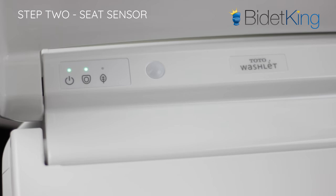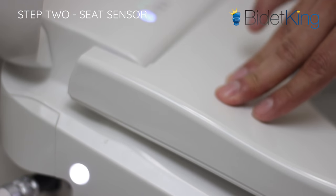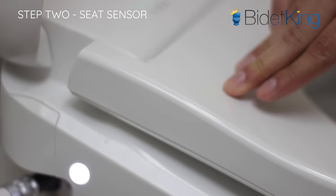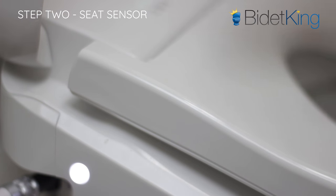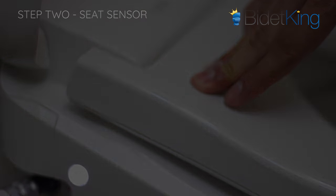If you have a Toto washlet or other bidet model that uses a weighted seat sensor, we'll have to trigger it using another method. With the seat down, press your hand down on the seat near the left rear hinge. You should feel a click. You'll need to press here and hold it down in order to trigger the seat sensor.